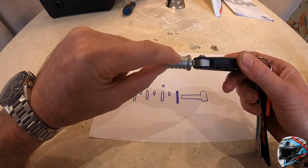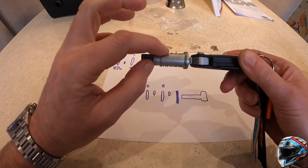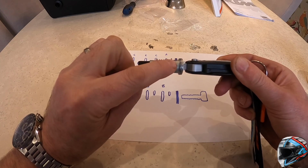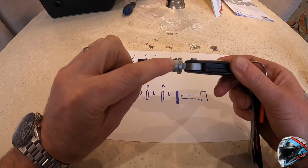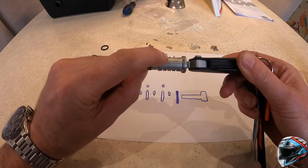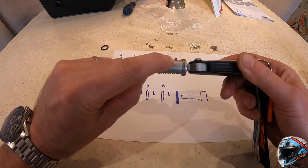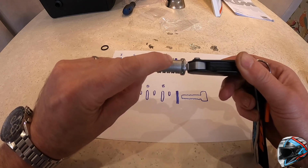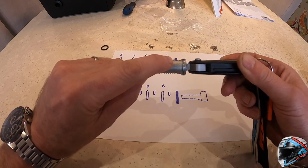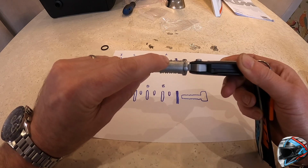You can look at the next slots C and E, and because these are elevated, you know that shim number 1 is not correct for that slot. What you do know also is you should be able to pick up there the shim in slot C is lifted by 2 grooves. I hope the video camera's picking this up, but there's 2 little grooves in there, and this one here has 1 groove.